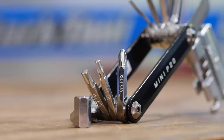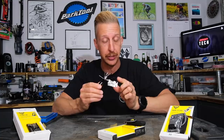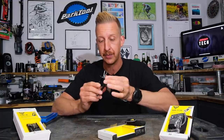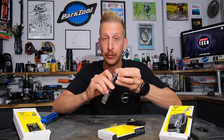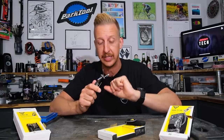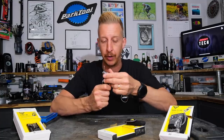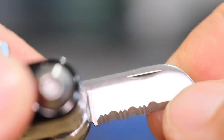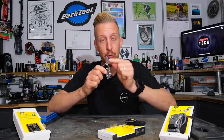The tools themselves are made from chrome vanadium steel — very, very tough, with nice sharpened edges. The sharp edges mean they're going to be a good fit and there's no chance of them slipping, which is essential with a multi-tool. There's also a Torx T15 and a T25 — the T25 is very common for disc rotor bolts and controls on the bars, while the T15 is becoming more popular. There's also a Phillips P2, great for adjusting rear derailleurs. Interestingly, there's a small blade with a slight sawtooth profile, great for trimming cable ties or tubeless repair plugs.